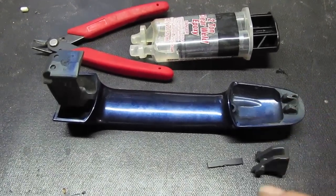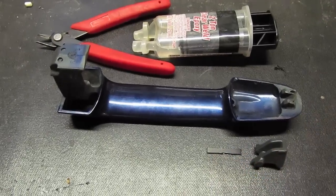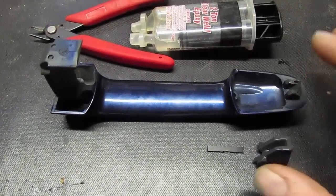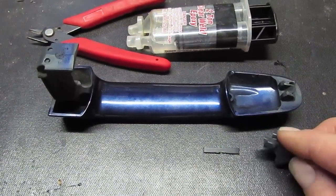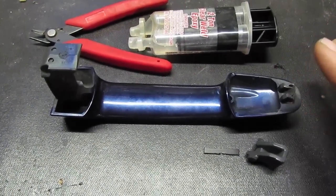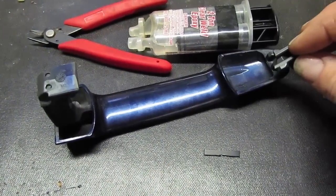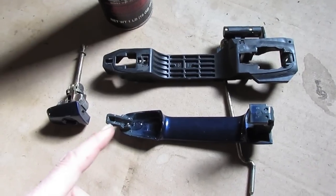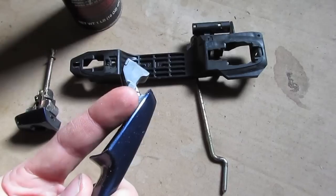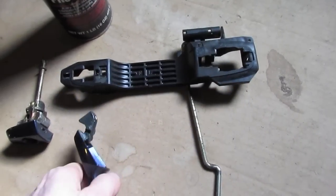Here I have the door handle and the plastic pieces. I've cut up some additional small tie straps — like electrical tie straps — and used them to reinforce once I start gluing things back together. I've cleaned everything with alcohol and etched the plastic to help the epoxy stick to it better. I use a long-setting curing epoxy — plastic epoxy would work good too. I have the lock assembly completely removed, and here's the door handle I fixed where I epoxied. I went ahead and ground around the edges to make sure it sits flush. You can test fit it in the actual handle assembly to make sure it's all good.